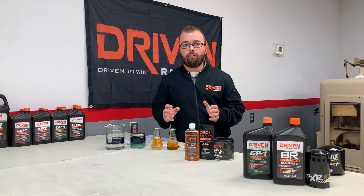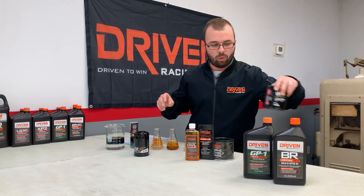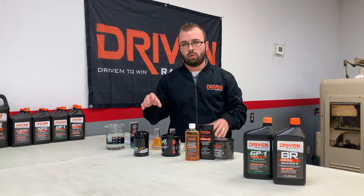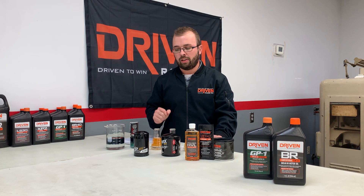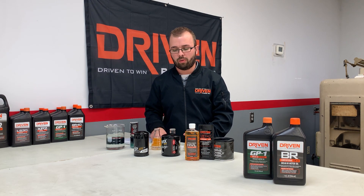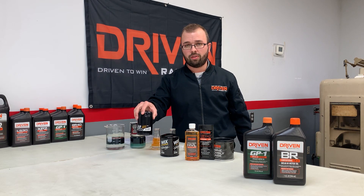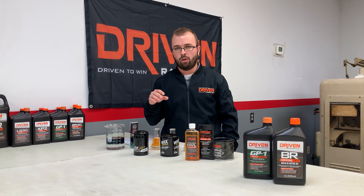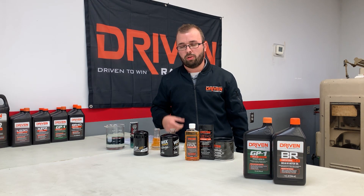Be careful about which oil filter you select. There are options like the Wix XP and the Wix Racing filter. For break-in, use a smaller micron filter because you want to catch those particles — you'll always have the most wear at initial run-in. A racing filter like the Wix Racing at 61 microns is too coarse; the Wix XP at approximately 32 microns is a better middle-of-the-road, high-flow, finer filtration option, or the standard Wix which is even a bit finer.